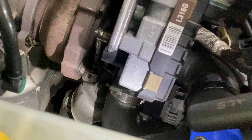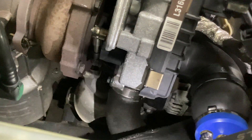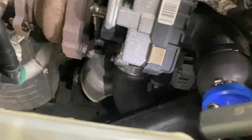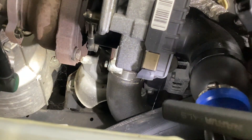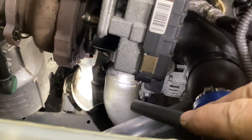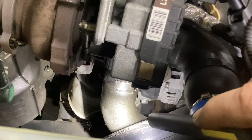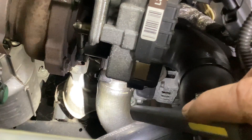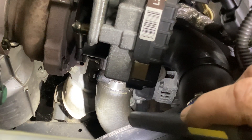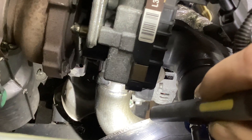What you're looking for is a leak on the boost pressure side or the outlet side of the turbo. In the centre of the screen where I'm shining the torch, you've got that turbo hose. It can split on the elbow, but more often than not some of the early ones will rub on the steering column and wear a hole through it, but they can just split. Feel your hand down — sometimes you can feel the split. Look underneath the car and you can see that oily black residue.